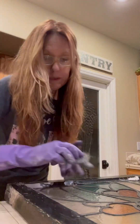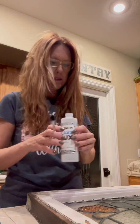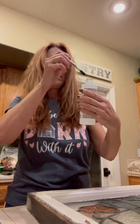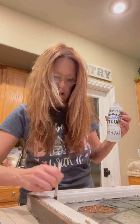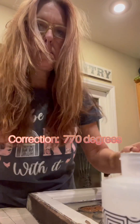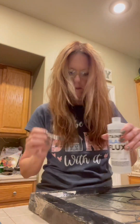So we're starting here. I've sanded those areas down pretty good — I've got three little spots that need to be soldered. We need to put this flux on those joints prior to soldering. Right now my soldering iron is warming up; it needs a temperature of about 570. This is the next step before we go into soldering those weak joints — just put a little bit of the flux in those areas.